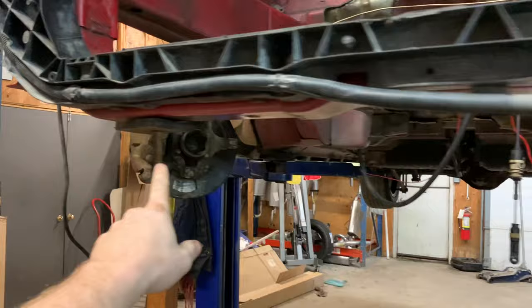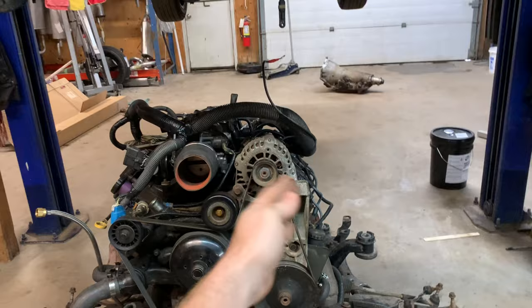I think it may have wiggled a little bit, just mainly from me pushing the transmission around and, you know, trying to get it in place and stuff. So it's going to be a process. Just put it down, wiggle it around, get the bolts lined up. Easiest way I've found to do it so far is to line up this bolt and this bolt, because they're rigid. Line it up with the frame down here in their spots, and then everything else will be pretty much lined up, and I can just buzz the bolts up through it.